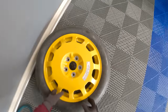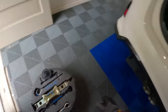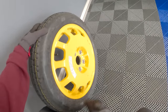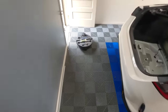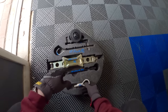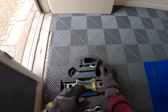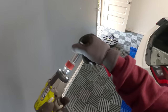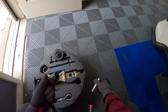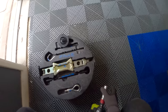So, some information about this: the 2005 to 2012 Acura RL is a 5x120 bolt pattern, and according to my research this should all bolt up. I bought this on eBay for $200 shipped. It came with a spare wheel and tire, this center insert with a jack, and your tools. This jack won't work on the Type R — it's for the Acura RL. We've got a screwdriver, and I also bought a 22-millimeter lug nut socket for about $13 extra on eBay. The Type R uses a 22-millimeter lug nut, and the Acura RL also has a 22-millimeter lug nut, so everything is pretty much the same.